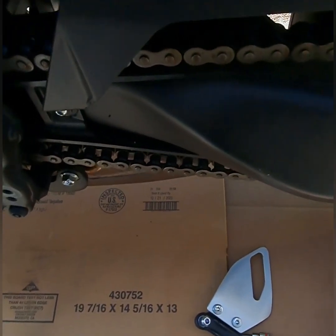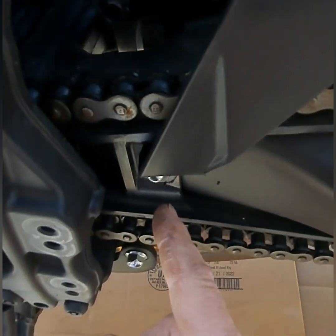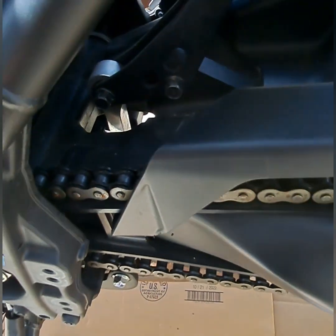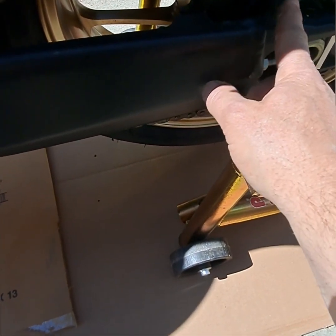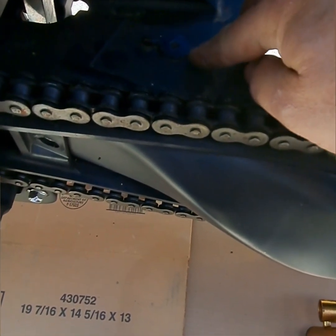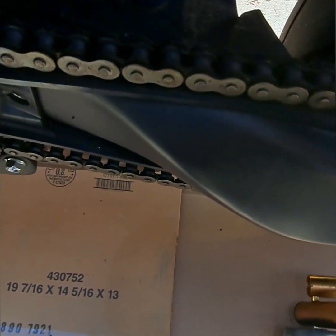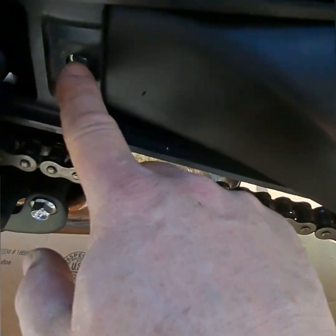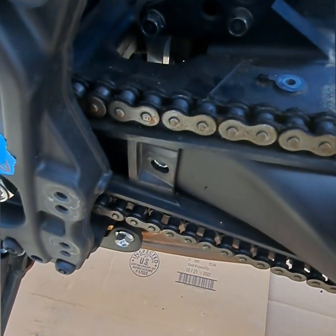I need to make a correction: it is number five over here for that first bolt you loosen on the plastic guard. But once you get that other piece off, it's not a number five over here — it's actually a number four. So on this plastic guard you've got a five millimeter bolt here above the chain, and on the right of the chain at the swing arm you've got a five millimeter. However, this one right here below the chain next to where the foot peg was — it's silver, not black, and it's not five, it's four. So you're going to need a four millimeter, a five millimeter, and a six millimeter hex.